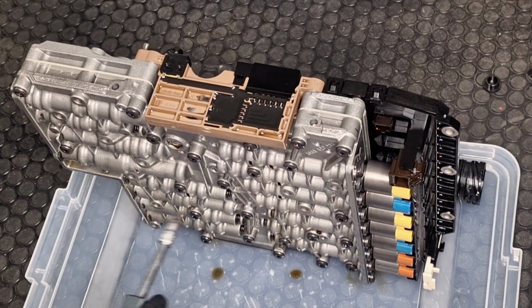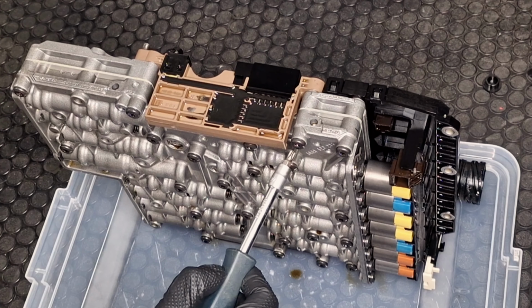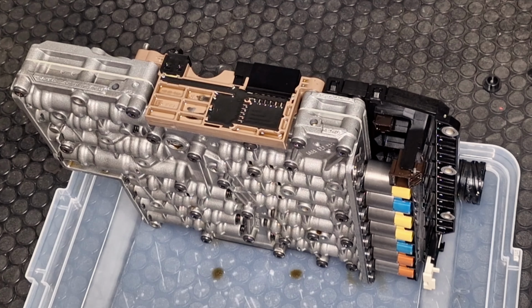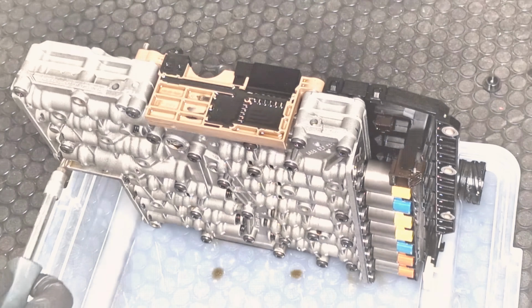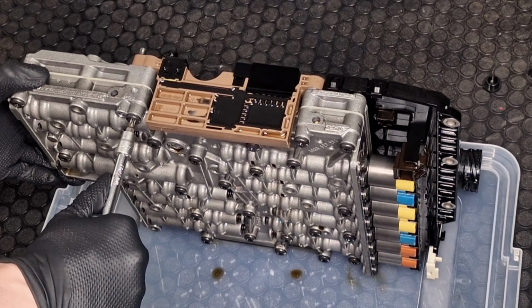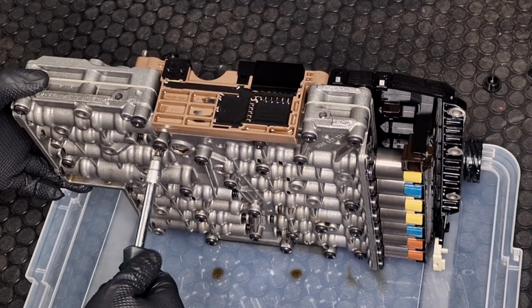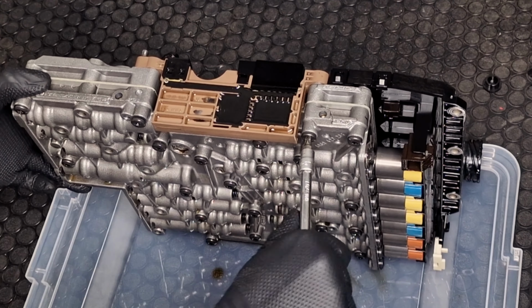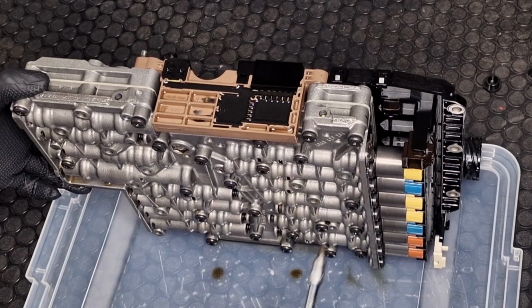there are several bolts. All of the bolts are Torx 27, but it seems like in this particular case the numbers for the valve body plates will be in the description. In this case I need to unscrew this bolt, those two, and those two, and it seems like that is enough. I checked it from the other side and it looks like it. So let's try. And those two.